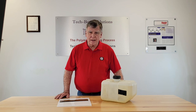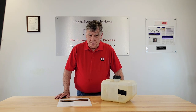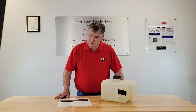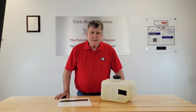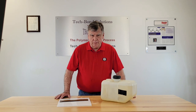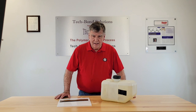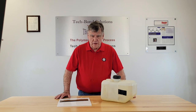You're about to watch a video on how to quickly, inexpensively, and most importantly permanently repair a hole or a crack in a plastic gas tank. If you Google how to repair a plastic gas tank you will get a lot of options. Unfortunately, over time almost all of those options will fail — for two reasons. One is those options are rigid. With any rigid repair, when the gas tank expands and contracts from either heat or simply putting gasoline in the tank, those rigid repairs will eventually crack. Vibration also will cause rigid repairs to crack.